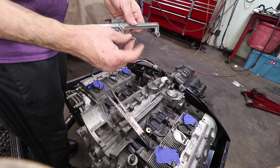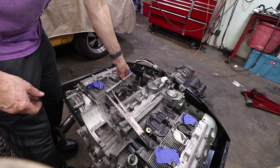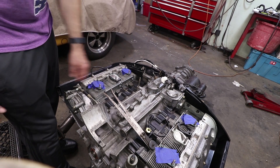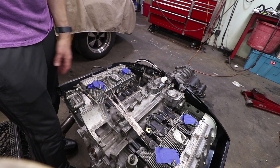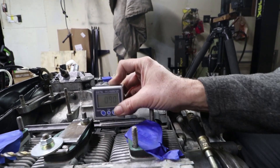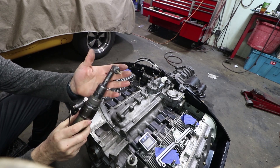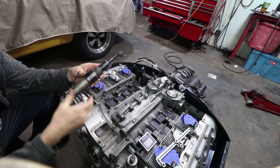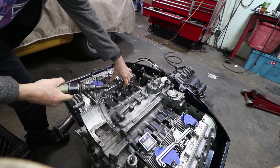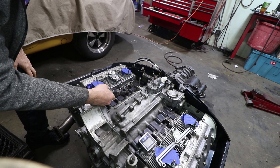Because it's such tight quarters here, we'll need to use a right angle drill bit — it's going to be a little bit tricky. We may have to shorten the drill a little bit, but we'll get this done. This is the drill I'm going to use — it's an air-powered right angle drill. I had to shorten the bit a little bit and I also shortened the bushing, which was sticking out quite a bit before, but it goes right in there.